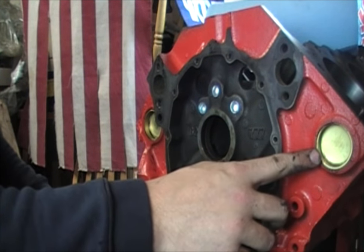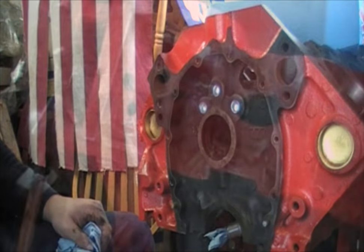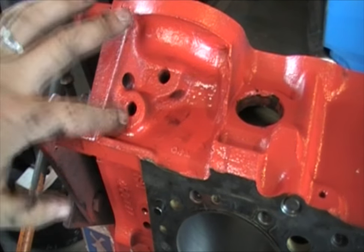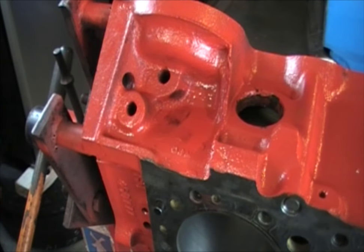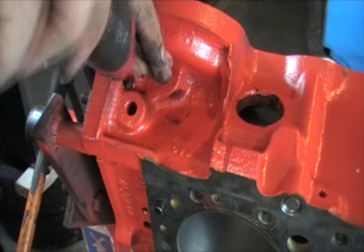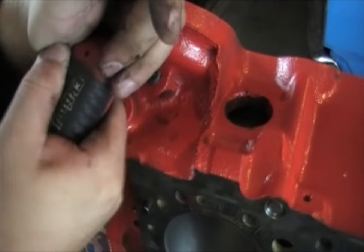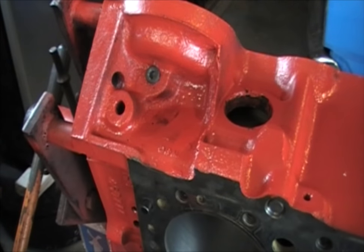You want to knock these down to just below flush — take them to flush and give them two or three more whacks, and that should put it to the proper depth. The next one to plug up is the one connected to your oil filtration system — it goes inside and into the oil filter. This one here just goes back to where the flywheel is, same with the one next to it, so you don't have to worry about those two. But the oil filtration one you really want to plug up, otherwise when you start your engine for the first time you're going to have oil shooting out everywhere. You can use Teflon on this one. I don't recommend RTV — you don't want any of that getting into your oil. Just crank it down and you're good.